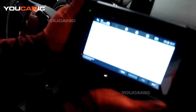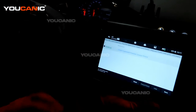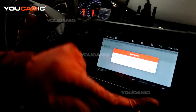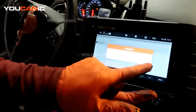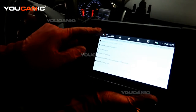We're back in the vehicle with our OBD-II scanner hooked up still and the key in the run position. Now we can go ahead and erase that code — clear it — because we did replace the sensor. That code has been cleared and it's clearing right now.